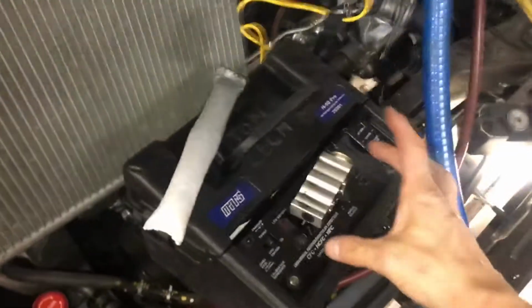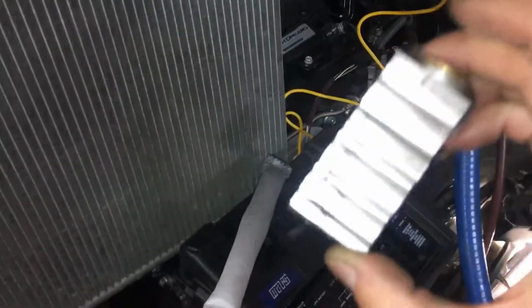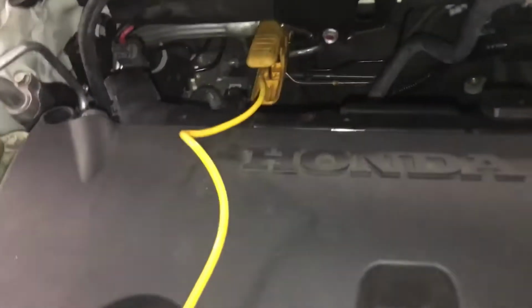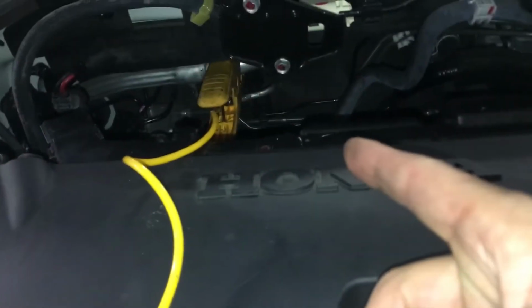Another 2016 Honda. So this one also had another culprit for a refrigerant leak, the expansion valve. On this one, you can see the black oil with the dust buildup was all over, actually. And back on the pipe that you can see my clamp hooked onto was all oily and black back there, covered with oil, covered with dust. See that liquid line down there?